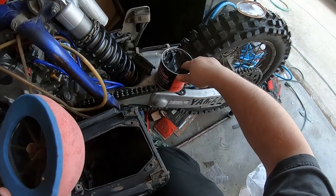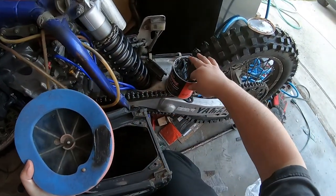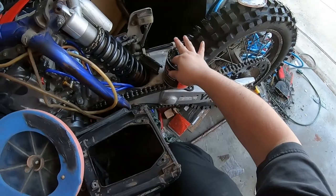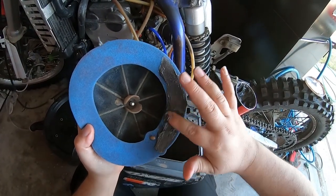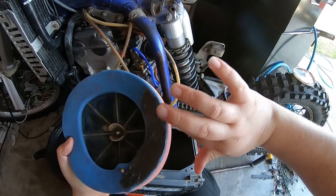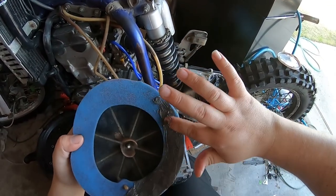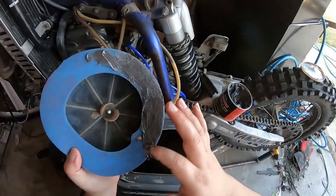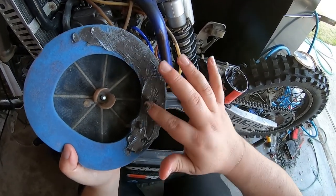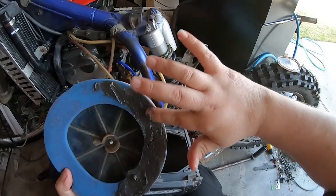You're probably wondering why I have grease here. The other messy part of dealing with the filter group is that you want to run grease around the rim — this is basically your gasket seal for your air filter to the airbox. How much grease do you need? Enough for a substantial layer — maybe like a sixteenth of an inch. Some folks in the comments might say that's a lot of grease. But a little grease is combustible and doesn't hurt your engine. Dirt, however, is not combustible and does hurt your engine. So maybe a little extra grease doesn't hurt when it comes to keeping particulate out.